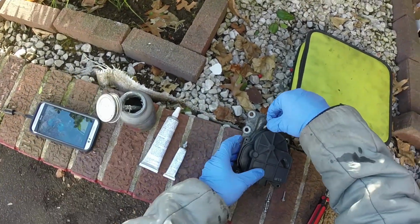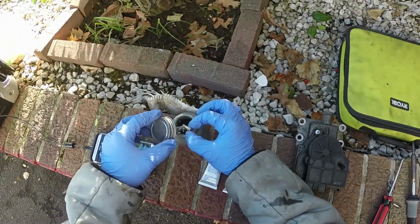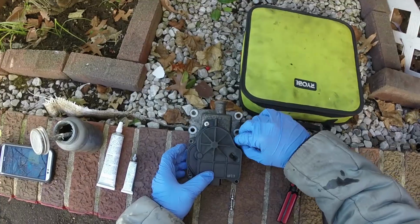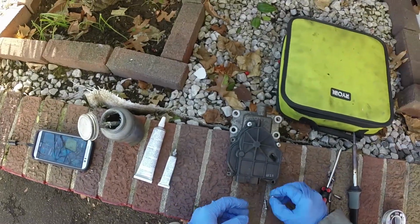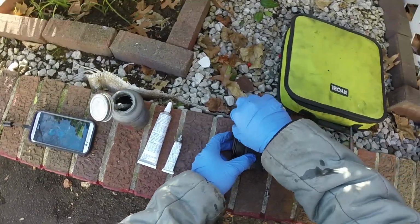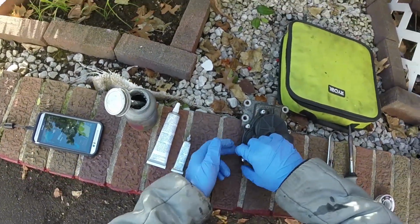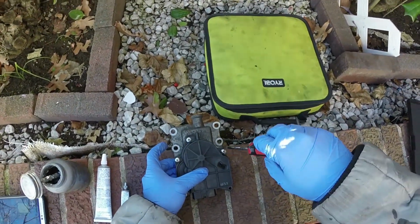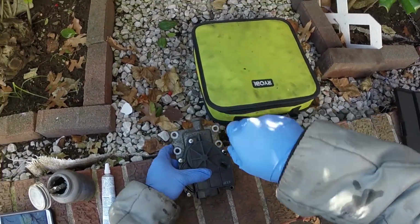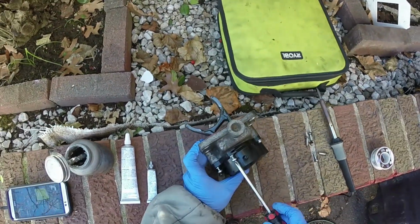The next thing you do is just reassemble that whole actuator assembly. So as you can see, the housing's back on, and I'm putting the screws back in place, and I'm using a little bit of anti-seize to put those screws back, because to tell you the truth, I actually didn't shoot this part where I'm trying to undo those screws, but they were so difficult. I had to use a locking needle nose plier and really muscle the hell out of it.